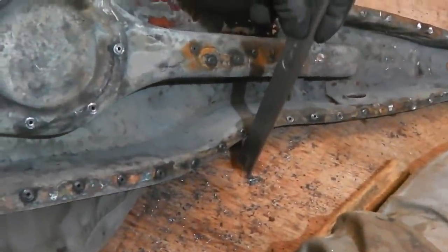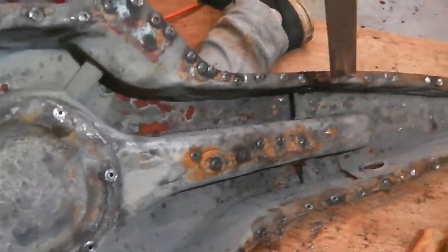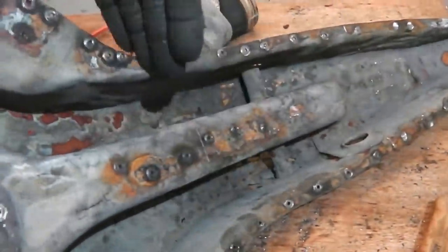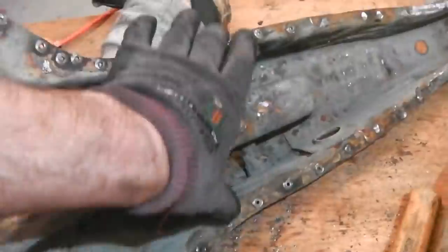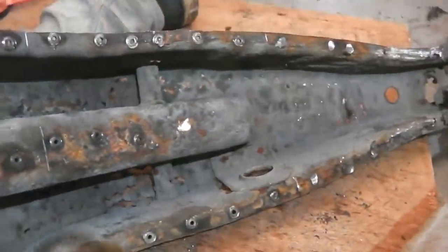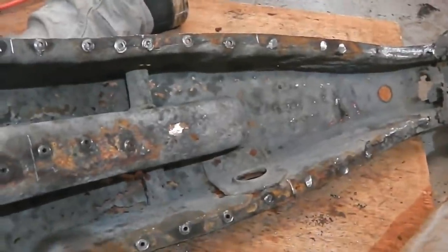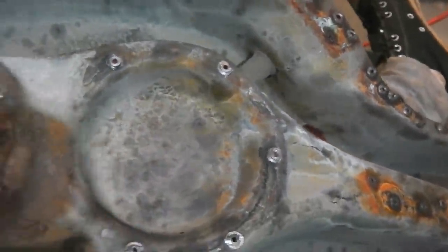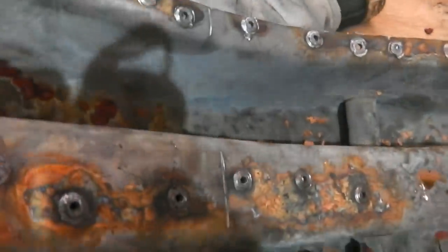So we need to take that out, right across, keep this. Then from that yellow piece of metal that you saw earlier on, cut that just forward of this. Then we only have to peel back that bit of that metal, so that's not many welds. That's only about 20 or 30 welds to get that cover off the donor piece. So actually not going to be that bad. I was thinking of having to unpick all of this again on the yellow one, but you don't. You only need it up till where the damage begins.